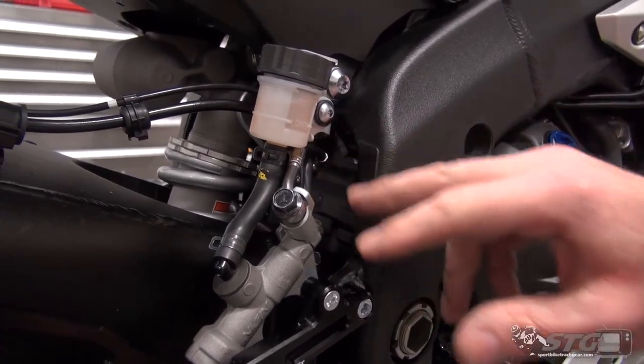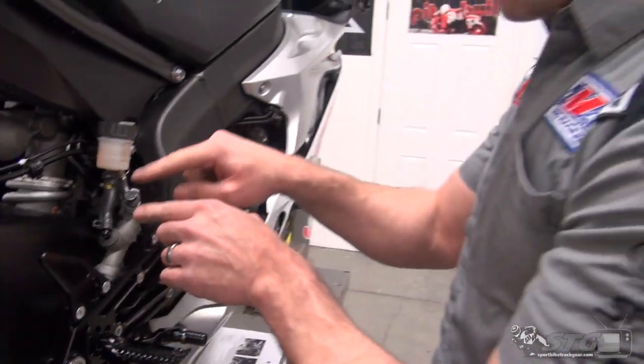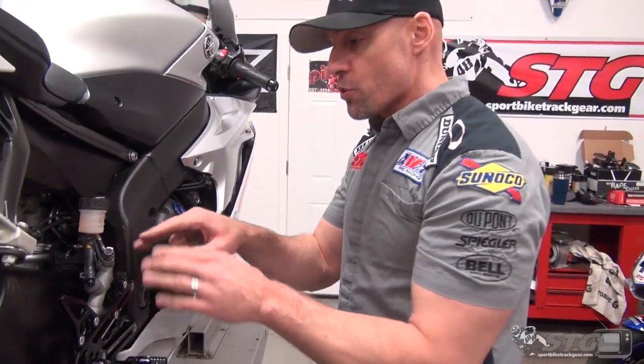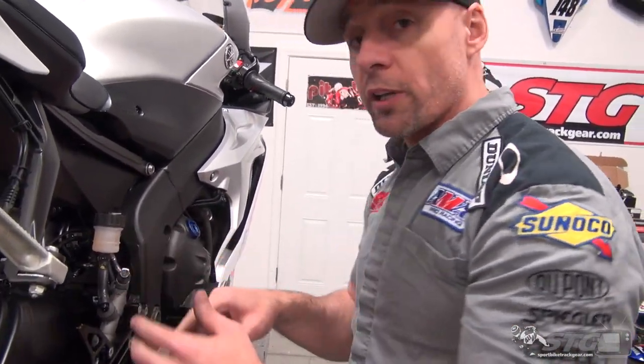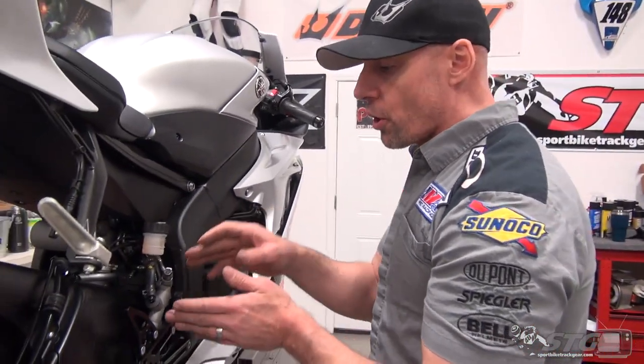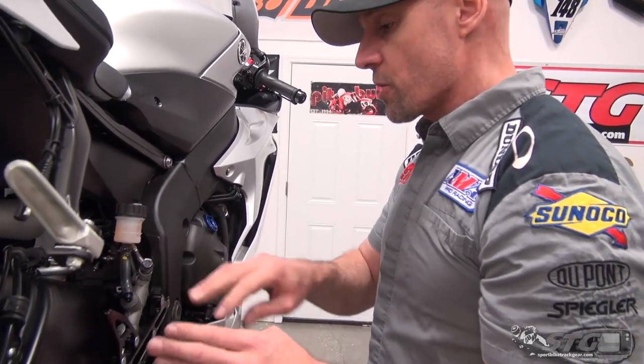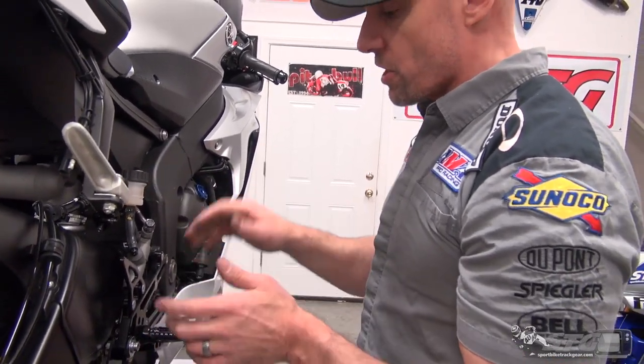It was with the ABS system on the bike and the brake lines — we have a Spiegler brake line kit on this. The OE rear set and the Driven rear set have a little different position, so I had to make a minor adjustment to the brake line. The OE brake hoses would probably be a little easier to work with since the stainless steel stuff is less flexible. That's something that's been a challenge with some of the rear set installs on the 17 R6 on the brake master side, but I was able to get past it and it all turned out great.